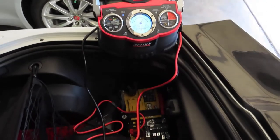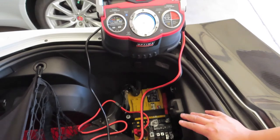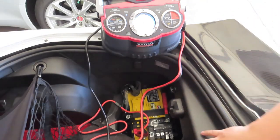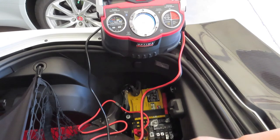So this particular battery has been dinged. I did a load test on this. It can only crank out 500 cranking power, instead of 870, or 800, supposed to be 800. Only about 500, so it won't start the car. And the voltage drops down to 10 volts. Even fresh off the charge overnight, I cannot start the car. Period. There's no cranking power.